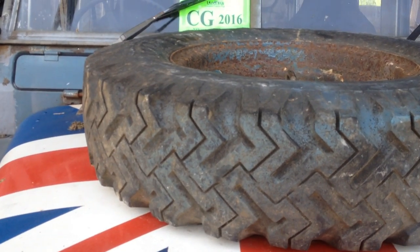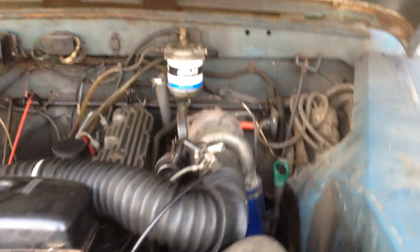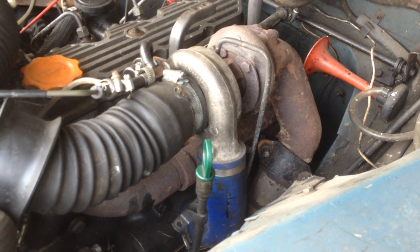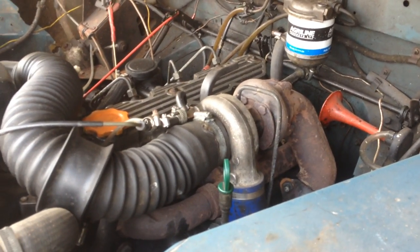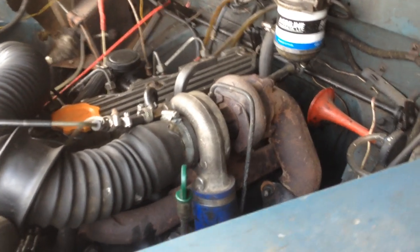The spare is a Goodyear Extra Grip - it's not the best on tread but it'll work. Engine-wise, it's a TDI - it's a 200. Lots of people seem to do the 200. Mine is a Discovery 200 although it looks like a Defender 200. It's got a 19J turbo on it - the old late-80s turbo diesel - no intercooler. It's a little turbo, only runs 9 pounds of boost, so it comes up quite nice and easy. Didn't want it to be too strong and destroy the gearbox instantly, because being 19 I do tend to drive reasonably quick.